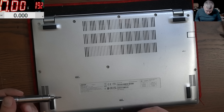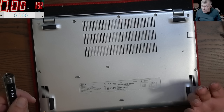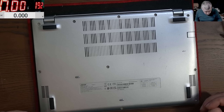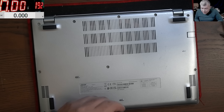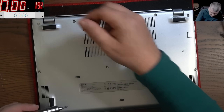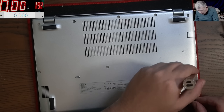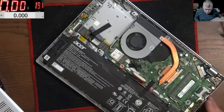Laptops don't normally spark because they have inductors and resistors in series with the 19 volts - they have a lot of protection against sparking. So I'm curious what kind of fault this is. I don't think I've ever had a sparking fault like this in the past. The laptop is now open.